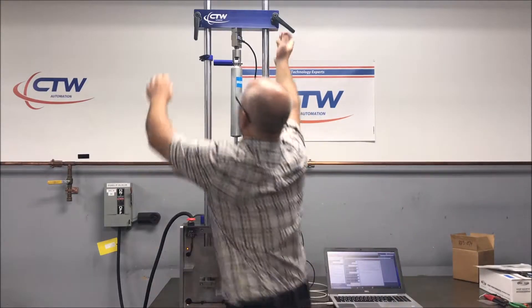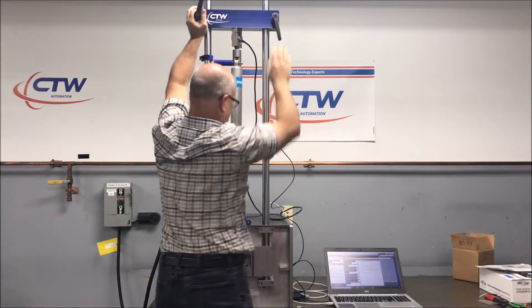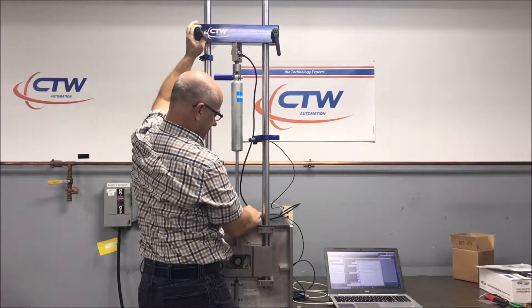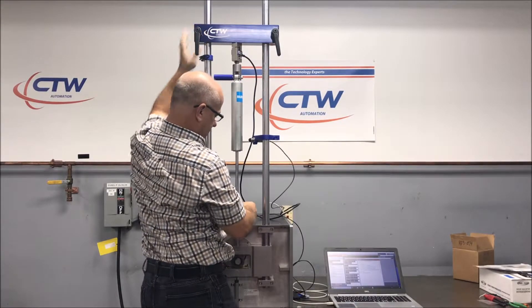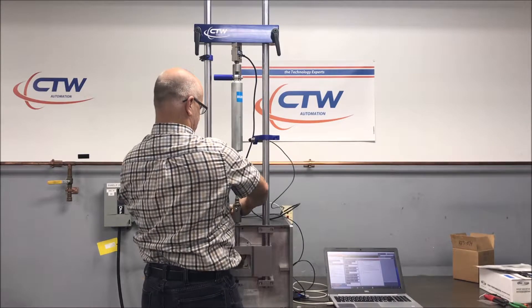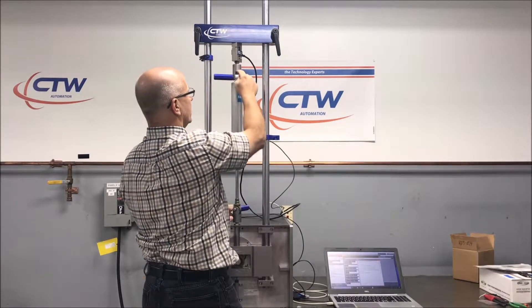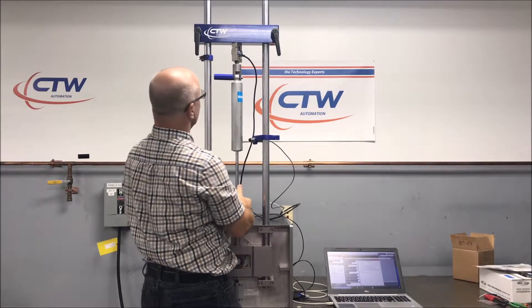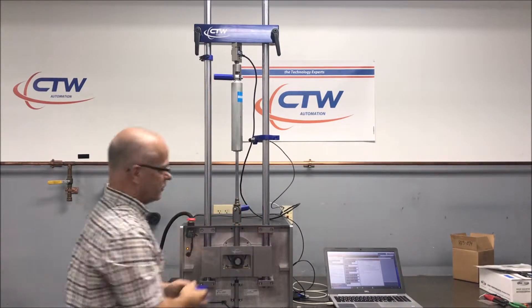So it's in the top — we're going to loosen the crossbar and let the damper come down to the bottom clevis. Slide your pin in, rotate so that they're both snug. This little bushing comes down, takes out the slop in the damper eyelet. Then the next thing you're going to want to do is set a preload.